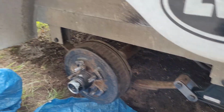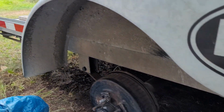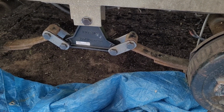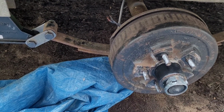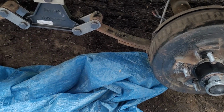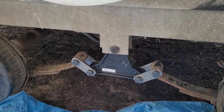So there you have it. We covered, other than breaking the jacks down in order to fix the stiff jacks that I was experiencing and any electrical issues that we might end up doing, suspension, bushings, brake service, and we got new tires. So I hope this video was helpful to some people. And oh, make sure you check the frame too. Make sure no cracks or anything like that along the frame. This is all galvanized steel, so I'm going to have to go and look for cracks.